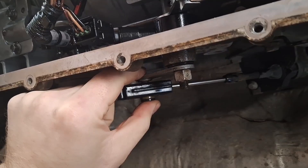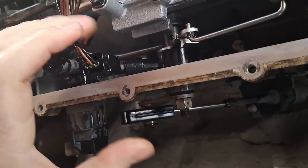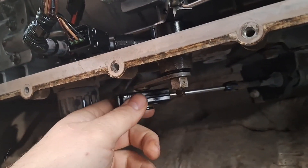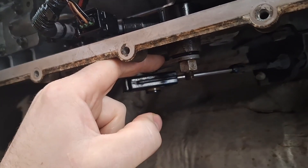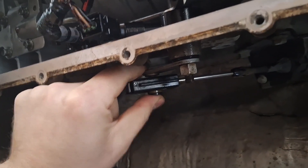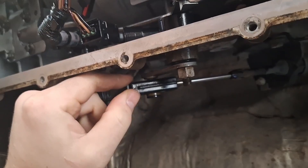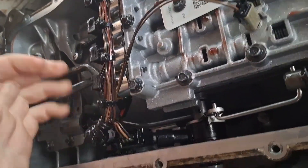Also make sure that your manual rod and shift cable here are lined up properly. If by any chance it's not dead on with the dimple that it pops onto, you might need to adjust the cable at that point. You shouldn't need to in theory because it's the exact same part you're putting in. But if you do, just pop the cable apart, move this around, pop it onto the knob on this lever here, put it together, and then put the two halves together on the shifter cable. If you need any more help on that, you can look up another video on how to adjust the shifter cable on a 6R140. Alright guys, have yourselves a great day. Thanks for watching. Get your pan back on and fill it up, and you're good.